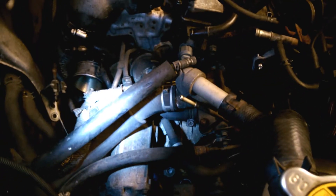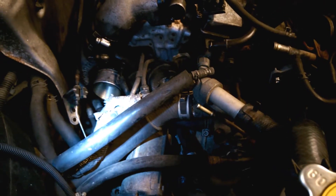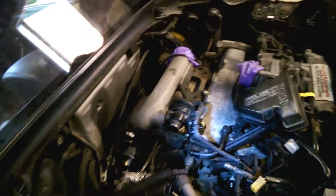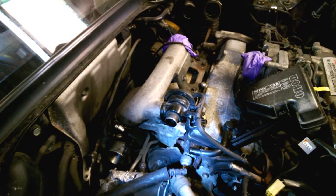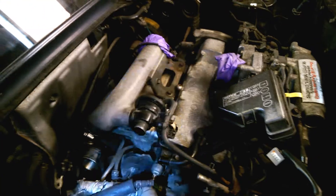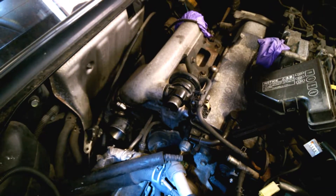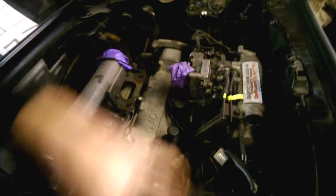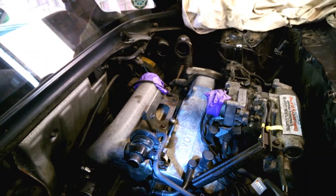The problem with the engine is that it basically started knocking terribly - not detonation, but a horrible big end knock noise - when I was coming back from work one day. When I stopped and turned the engine off, it seized and I couldn't restart it. It's still seized. I'm guessing it could be a big end or a main bearing that's picked up. Unfortunately it means taking the whole engine out, dismantling the whole thing, or at least taking the sump and crank out. I've got to split the gearbox off to find out what's wrong, then maybe get the crank reground and put some new oversized bearings in and rebuild it.